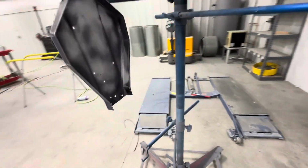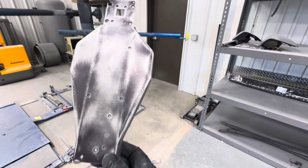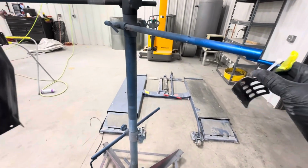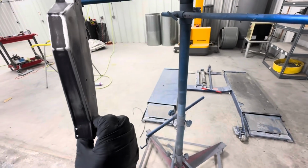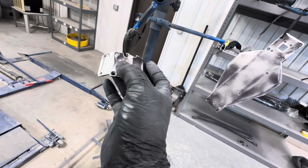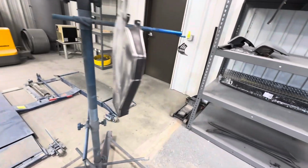All right, we got everything worked out. Put a little metal glaze over top of where we did the panel bond. And we're going to wipe this down with a metal etching wipe, just for the direct metal situations. We got a lot of raw spots. We didn't strip it completely, but got most of the gouges out. Put just a touch of filler right there. I will be running the front bumpers, so hopefully that won't get knocked off.